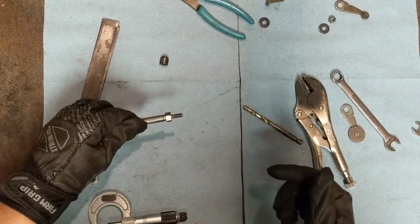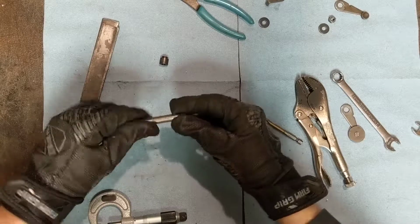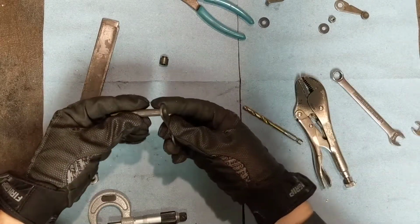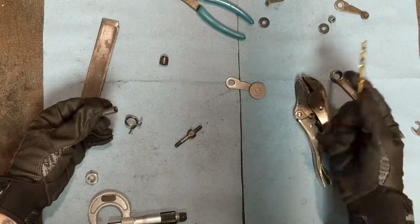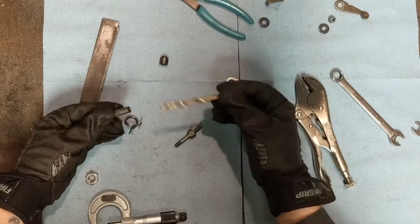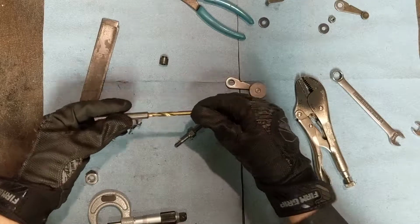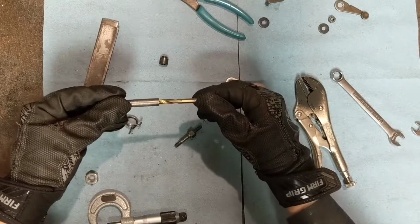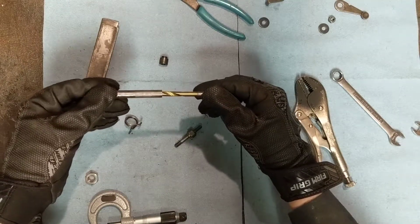That's about what we needed to do, and all we need to do now is get it so this detent lever will slide over there. To make sure we're concentric to this, we're going to use a trick I saw on Stefan Gotteswinter's channel. I'll put a link in the description, and we're going to Loctite this to this drill bit. Then when we're done with it, we can heat it up and pull it out.